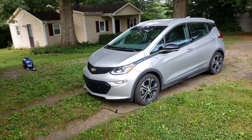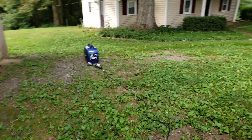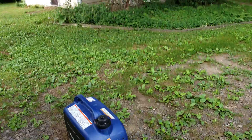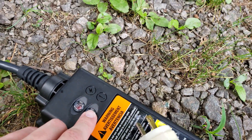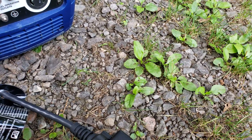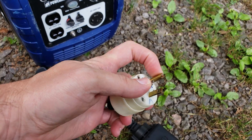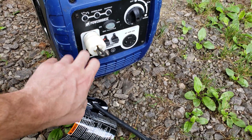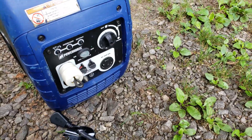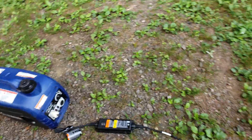Just to have the generator as a backup. The problem with these generators is they're not bonded internally for the neutral ground, so when you try to connect them you're going to get an error light. Basically on the charger this red light will come on unless you make a workaround — it's a plug with just a loop going between the neutral and ground. When you plug this in, the neutrals on all the plugs are now grounded, so when I start it up it'll go green and I'm able to actually charge the car at 12 amps.